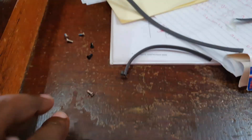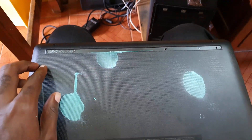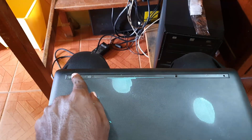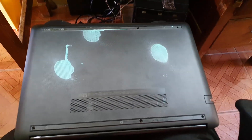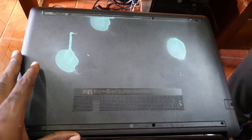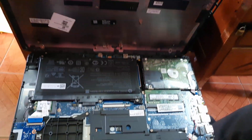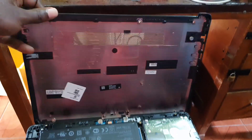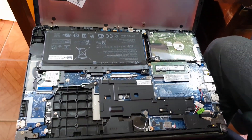Now I'm removing the last screw. Once all six screws have been removed, the rubber grommets are removed as well. I'm pointing them all out — six in total. Once you do that, use your card and slide it along the top edge, flip it back over and it should open effortlessly. The back will simply snap off. Don't yank it aggressively, as sometimes there are connections between both parts — on this HP, however, everything is to one side.